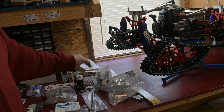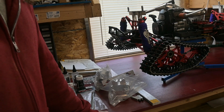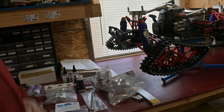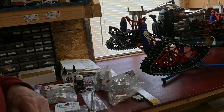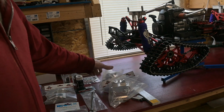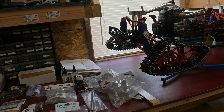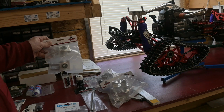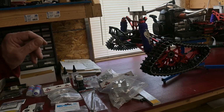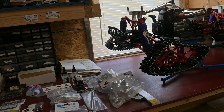One note: if you have these Rovans, for some reason they do not put differential fluid in there. They only run grease. So if you ever buy one of these, you really want to take the thing apart, get the grease out, and put differential fluid in there. I do have RC Max front and rear differential housings. I'm going to stick with the actual differentials on the Rovan for now to see how they hold up. I did get the rear hubs. I haven't got the front hubs and spindle sets yet. I haven't been able to find them.